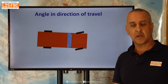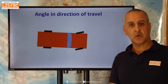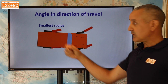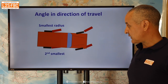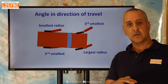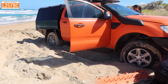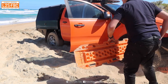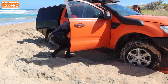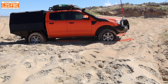When the vehicle is not traveling in a straight line, each of the four wheels creates a different sized arc, so you have to position the ramps appropriately. The smallest radius is the inside wheel, the second smallest is the outside rear wheel, then the front two wheels. So angle those ramps so that as the car moves off it gets on top of them — the direction will obviously not be straight ahead. The vehicle is turning, so it's not dug in, but I need to angle the ramps to match its path.